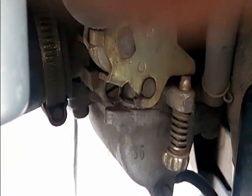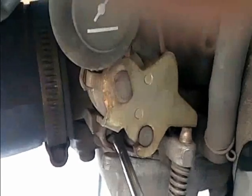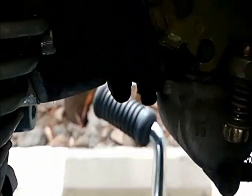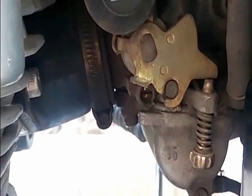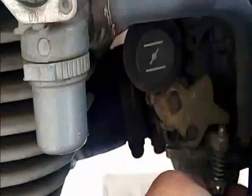I am going to tune the engine. The AFR screw has to be tightened first — that is clockwise. Basically when I close the AFR screw, the engine should switch off. That is the reason I kept the RPM a little high. It seems it requires a bit more, so I will increase the RPM some more.